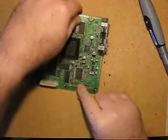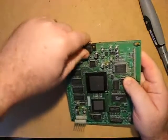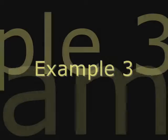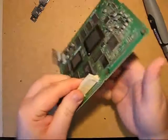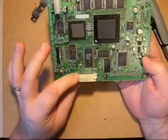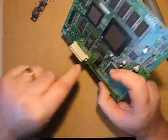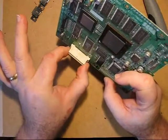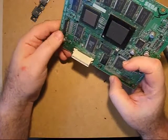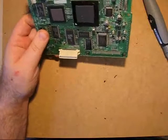If that thing moves, you can slice your finger off. Get rid of this for the rubbish — off she comes. This sort of port is a little bit more complicated because you can't just cut through and hope for the best. It's the same type of principle though: we want to cut down as low as we can across both sides, again avoiding the board. This part will then lift off and we can pry the rest of this plug away from the pins. Never force it, otherwise you can end up pulling up the traces on the pins themselves, which isn't a good idea.